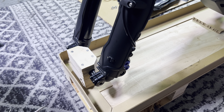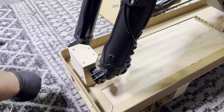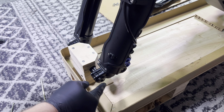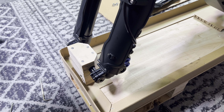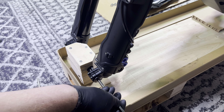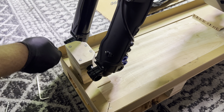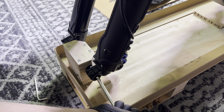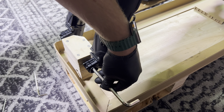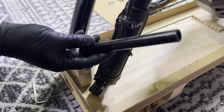Now it's time to remove the front axle from this wooden block. To do that, you need to be sure all four of these pinch bolts are loose. Then grab your 8mm wrench and back out this bolt a few turns on the disc brake side. This may pop out just by hand, but you may need to tap this with a rubber mallet to kind of get the fork started. Then it is going to be time to fully remove this bolt and set it aside. You can try pulling this out by hand — sometimes it comes right out, sometimes you need to push on it. The ball head of this 8mm is pretty good — you can just tap this axle all the way up. Now you have your axle removed.